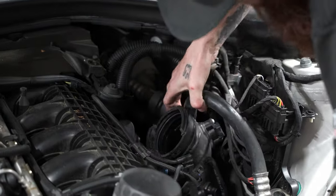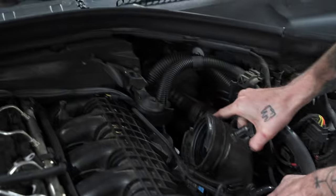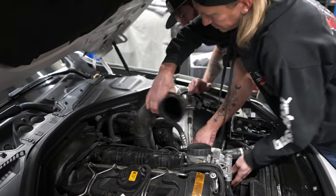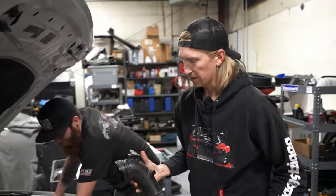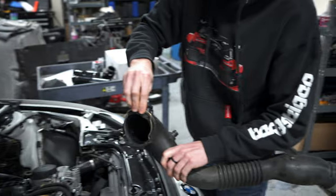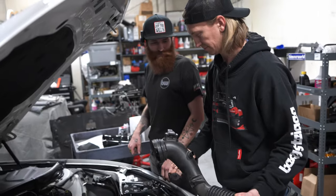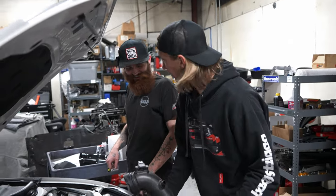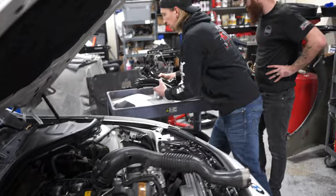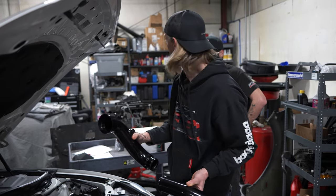Get that right twist. Is this really a two-person job right now? Look at that — a real mechanic! So it broke apart right here — this is where they normally break apart. This big C-clip goes here and where it secures that plastic, it just went. That did break. You can see this is a big one-piece thing where it's got a route under the AC compressor and over to the intercooler. The Evolution Raceworks system is two-piece, so the install will go a little bit easier.